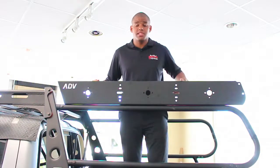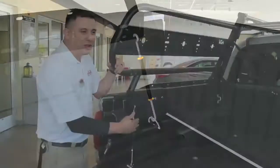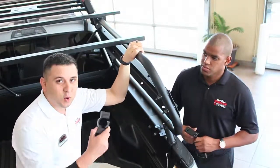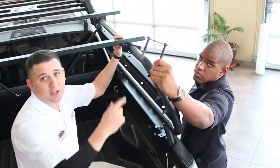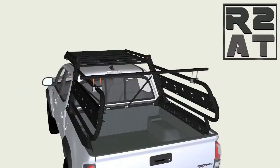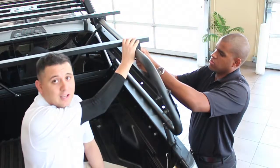We're getting to the final steps. Next up is the Expedition panel — it's going to go right about here. For this step, take your turnbuckle and tighten it down, along with the jam nuts, to make sure it locks in place. These anchor down the weight distribution toward the front of the rack. Pretty much the last step before you torque everything down: put your base onto the rack — it's adjustable, so slide it back. Put your anchor into the crossmember, add the washer in between, line up the bolts, push them into the base, slide it in, add the bottom washer, and bolt it all down. You're done.